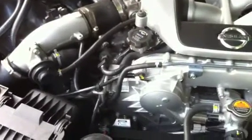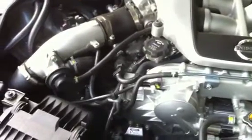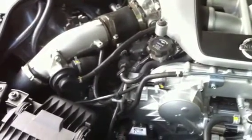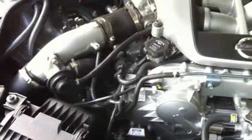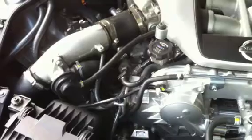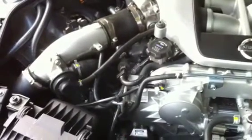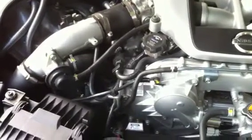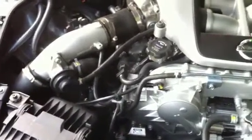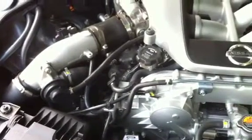After that first oxygen sensor, you've then got the primary cat, and then after that you've got a traditional narrowband oxygen sensor, which is there to check that the catalytic converter is working. After that you go into the mid pipe, where you've got 2 more cats, and then that joins together, and then you've got your cat back section of the exhaust. Some of the big gains on the GTR can be achieved with a mid pipe, which removes these 2 cats, and that doesn't throw any codes.